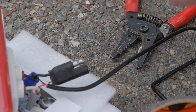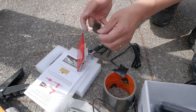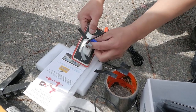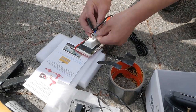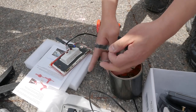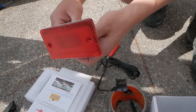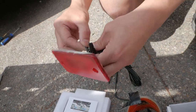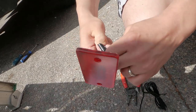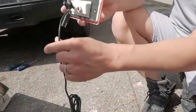I like doing it in two steps — I'll do two little skinny strips like this, get it right through, and then put a little bit around here just to make sure that this butt connector does not move ever. That side is not going to move. Then take another piece of tape and secure the white wire side so it doesn't move, because this is not like the back of your drywall — there are no bumps here. This is going to be on the road and RVs are pretty bumpy, so I want to make sure nothing's moving.